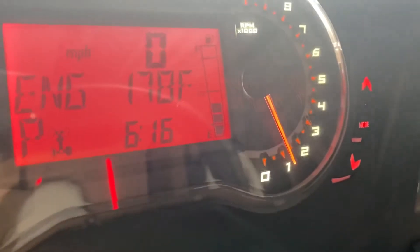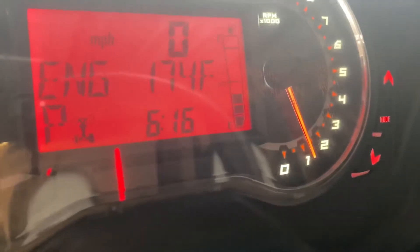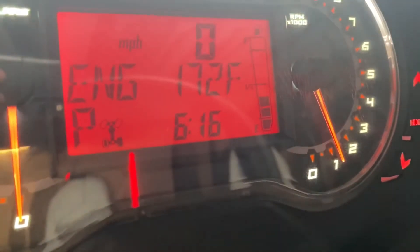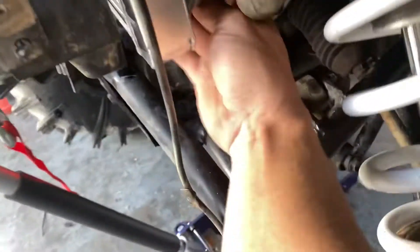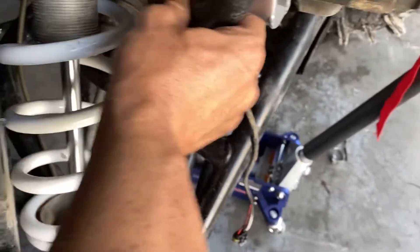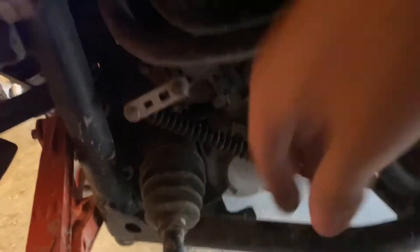You want to wait until about 180°F — that's when the thermostat opens and lets the coolant circulate. You can see the temperature going back down because the thermostat opened. Let it cycle like that a couple of times to make sure we have enough coolant flowing from the radiator to the motor and back. The entire time you just want to massage the hoses to make sure they're getting warm and to keep coolant moving. Keep working that cooling around, making sure any air bubbles are coming out and keeping an eye on your reservoir — still full, which is good.